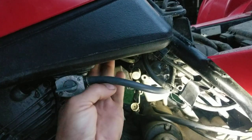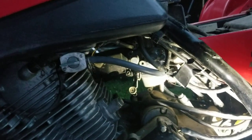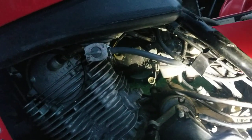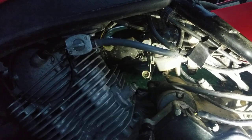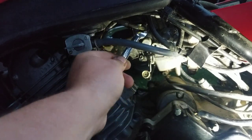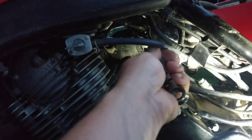Get the wiring out of the way. Right up in here, it's kind of hard to see — let me tilt the camera down a little bit. This right here is your choke cable and it's screwed in. It's plastic, so you want to make sure you're being very careful with it. It's either going to be a 12 or a 14 millimeter — in this case it's a 12. Those are the two common sizes whenever you're dealing with choke systems on any Mikuni or Hitachi carburetor.